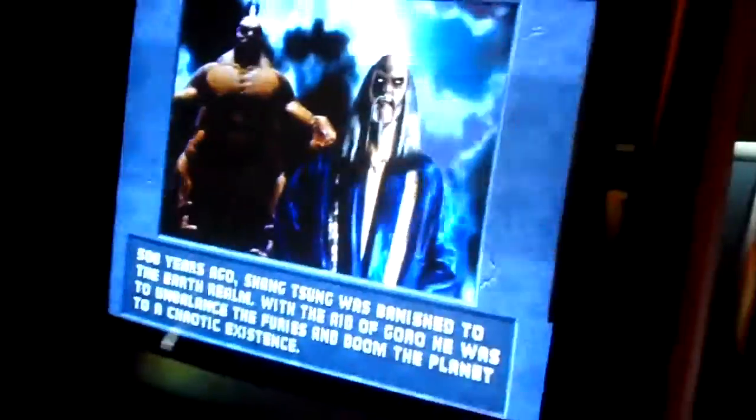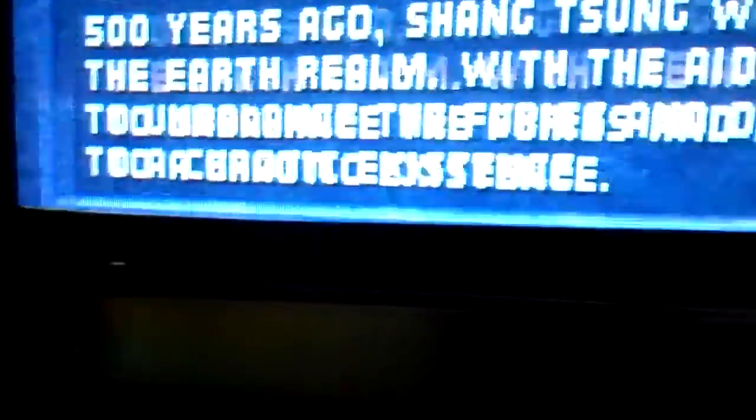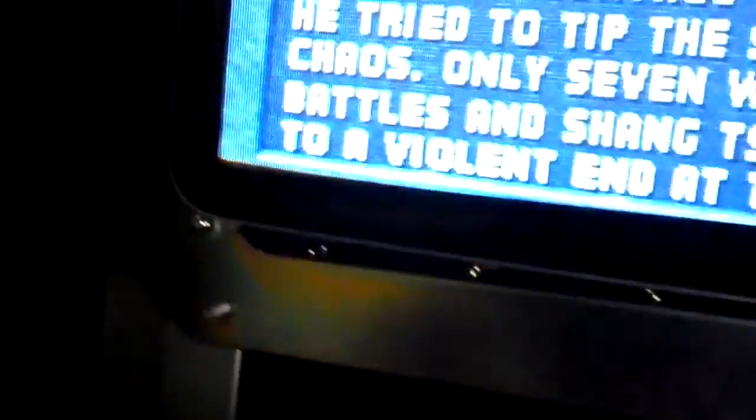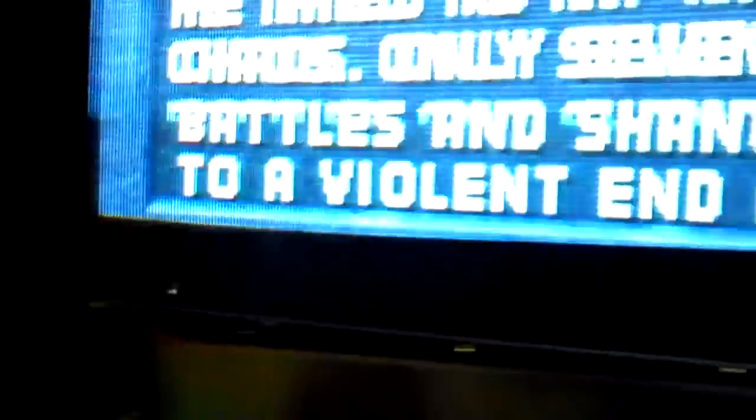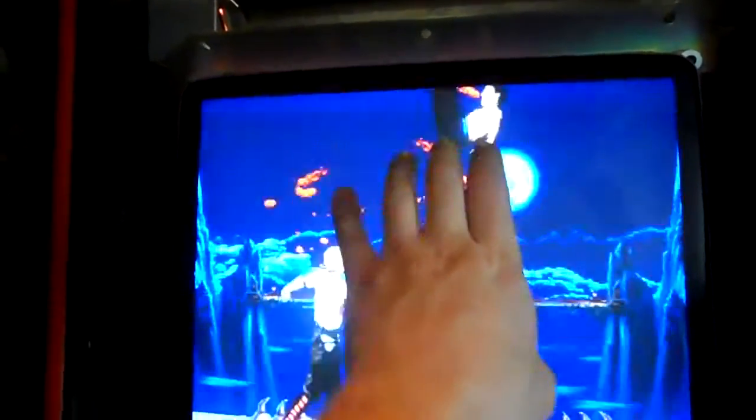And there it is. Brand new 25-inch tri-mode Makvision. Looks awesome. And you can see, well, maybe not now, but there you can see right there, and you follow this along, it's down below over here. You can see the corner, there's a gap between the bottom of the text block there. Over here you can't see it, so the image there, you can see at the top here how it's higher over there and lower over here. The yoke is kicked that way, so I need to kick it back that way to straighten it out, but I can do that later, no big deal.